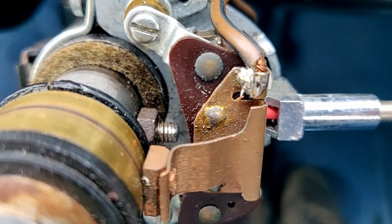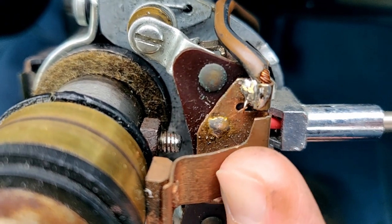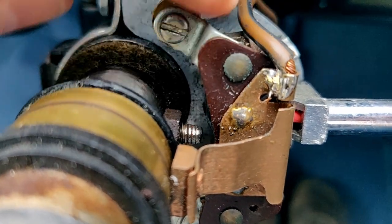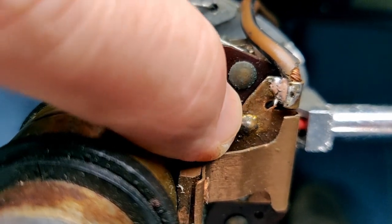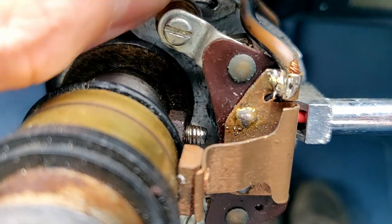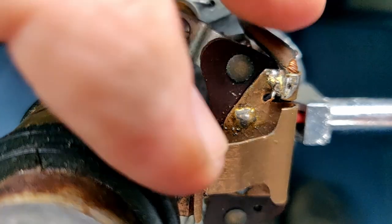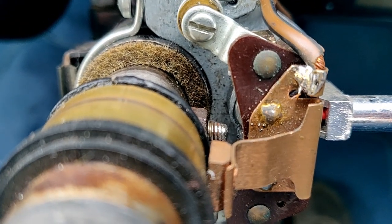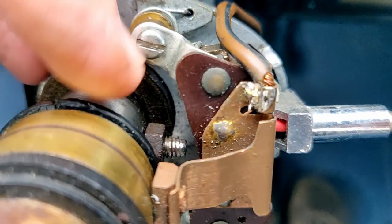On this car when we got here, this arm was actually broken and I had to re-solder it onto the insulating plate. So you can lose your electrical path when this bit is missing or broken — and that could be a reason why a horn isn't working.